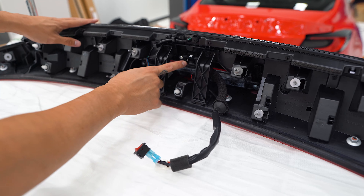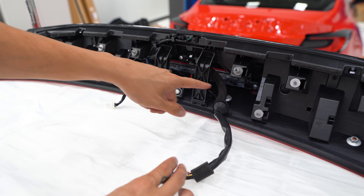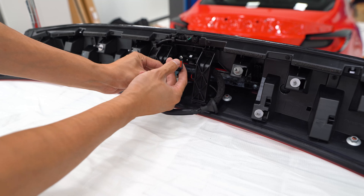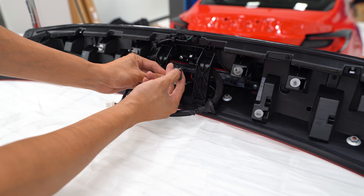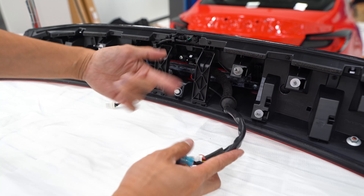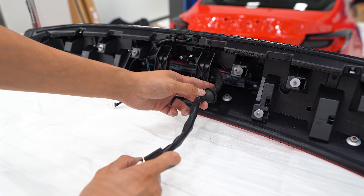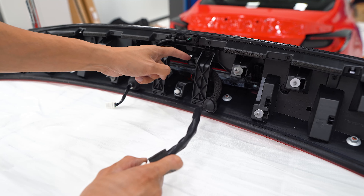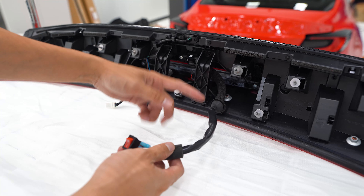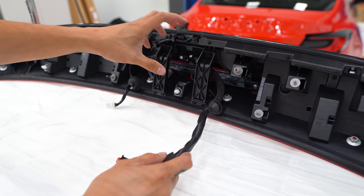So let's talk about why I removed my reverse camera. You can see there's another harness that comes out from the light we just installed, and that goes to this switch here that controls the F1 blinking function, so you can turn it on and off. To get that inside the car or trunk you need to run it through the same spot where the wire for the camera goes. That's the reason I just swapped the cameras over — I didn't want to pull this harness out of the sheathing we've already installed, so I just installed the whole assembly.